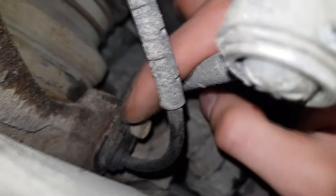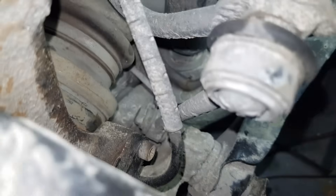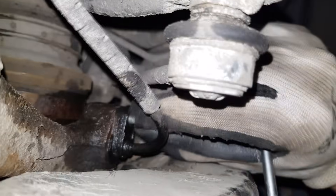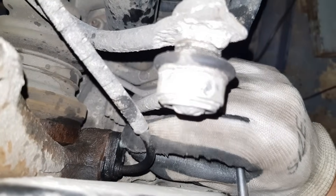The corrosion on the drive shaft just pushes the ABS ring near the ABS sensor, and when it touches that sensor the system is activated. Usually this ABS sensor is really stuck, so it's good to use WD-40 or some other penetrating oil. I used pliers and a screwdriver to move the ABS sensor away from the ABS ring — there is no need to move it all the way back.